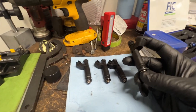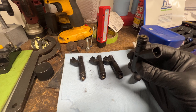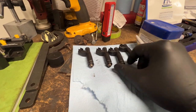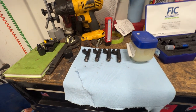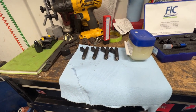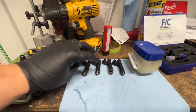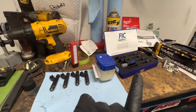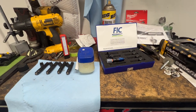What I've been running all these years — these are 60 pound per hour, I think they're like 630cc. Siemens Dekas, no issues with them. Obviously the truck survived for the last seven or eight years turbo with those in it. You can typically get them at a reasonable price. So let me finish this side, do the other side, and then we'll talk about settings inside the Holley.